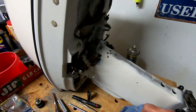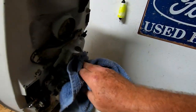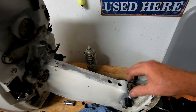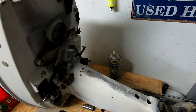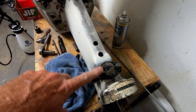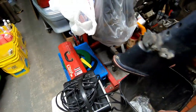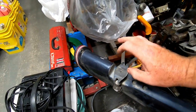There's a way to revulcanize them back together but these things ain't cheap — more parts to order. That's why I want to get the whole tear down done before I order parts. So we need the rear lower motor mount, two upper side mounts, and an upper center mount. This lower motor mount is discontinued, no longer made by OMC. So what I did is I went and searched all over the internet.